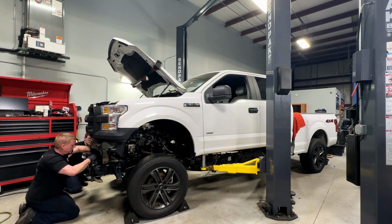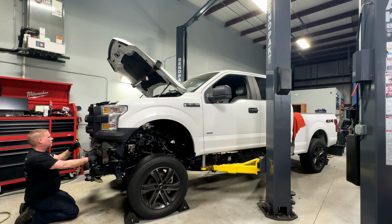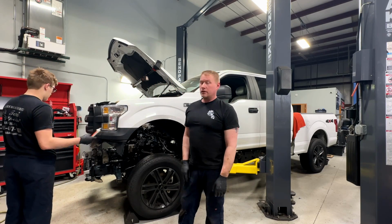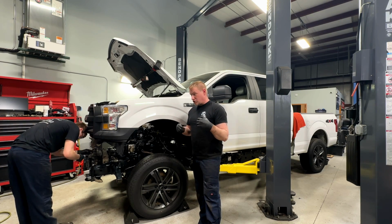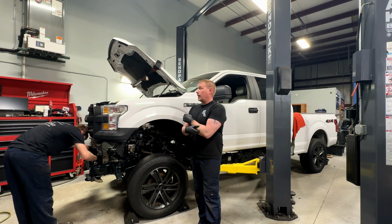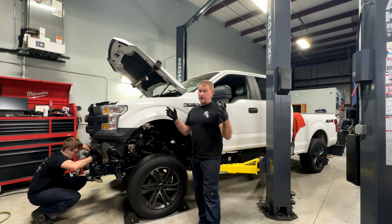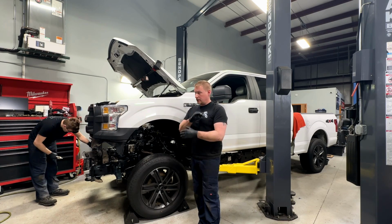First pins are, wait a second. Where's the electrical grease? I don't think it's seeping in there all the way. It's all dirty. So if you guys ever have any issues with electrical connectors, especially in a vehicle like this, go ahead, put it on there. Electrical connectors where you try and push them together and they're dry and the rubber in there is dry, or they have a lot of dust in there, of course, blow them out. But also you can use the XG12 electrical grease from Motorcraft, and it'll just make everything lubricated, and especially that seal, and it'll slide right together and click like that. No problem. You have a positive click, you know it's secure.